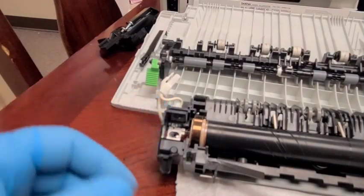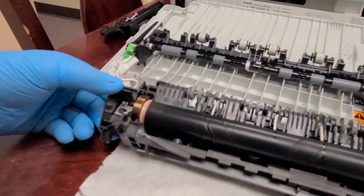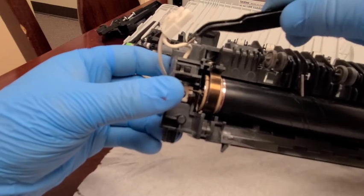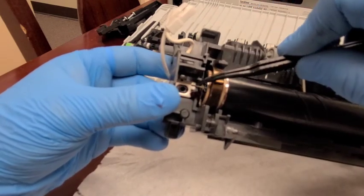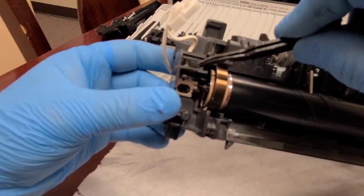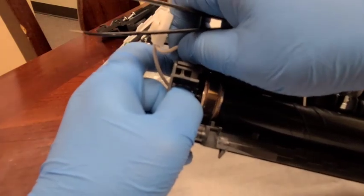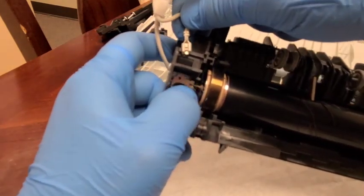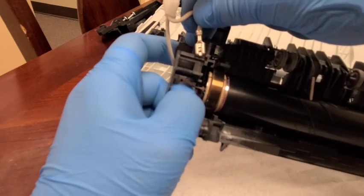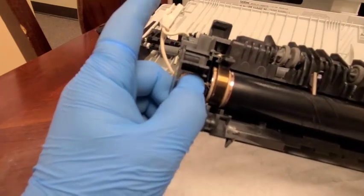On the left side, there's a wire connecting to the heating element lamp. To disconnect it, hold it down and pull on it. I pressed my thumb down while removing the wire — I probably should have done this before removing the screw, just to avoid bending anything. Now we'll let the wire loose in the back.